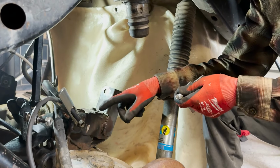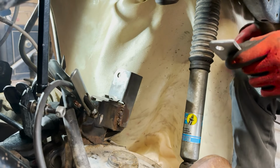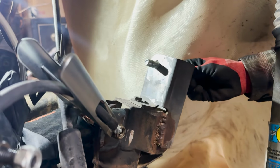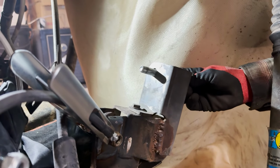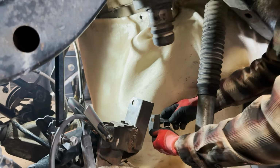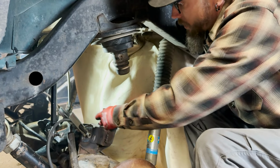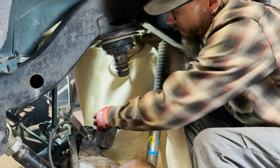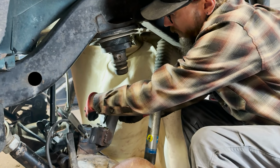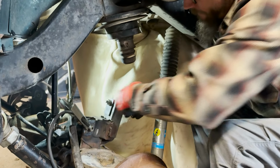So we got the back control arm plates and reinforcements glued in. And then I found the same thing on my rear track bar mount here. I've just got a little extra play, and any play like that where it's wallowed out is just gonna get worse and worse. So I cut a couple more brackets and we're gonna sandwich those through either side on the outside with the appropriate holes, and burn those on for reinforcement.